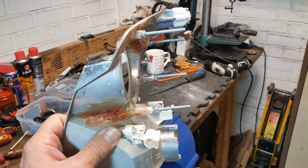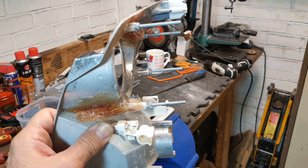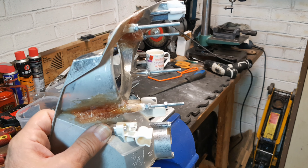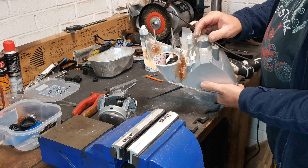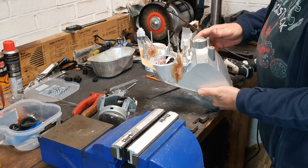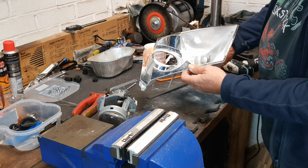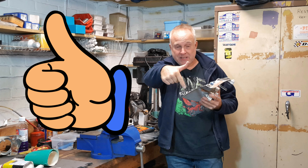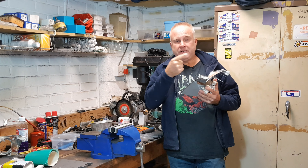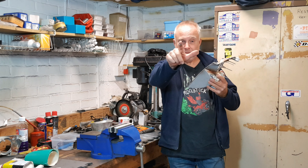Now repeat that process on all four of your studs, and hey presto — we have a reflector with repaired bosses and custom studs, ready to accept a new projector. All the studs are almost identical length; absolute fractional accuracy is not essential. This reflector is now ready for use. You can use it as is, put the original projector back in, or move on to custom painting. If you got value from this video please give it a like, and I'll link you here to the next video in the series once it's been done.